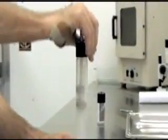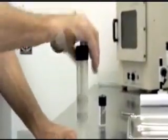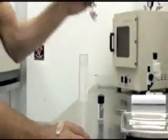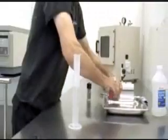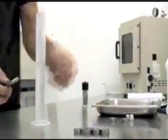After waiting, pump 20 or 30 times with a little bit gentler, shorter strokes than the first time, with the bottom bearing hanging around the 45 cc mark. This helps not to stir up the alcohol and the dirt on the bottom. Remove the bearings and set them on a clean, dry table. Install 2 more bearings and repeat it again.